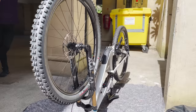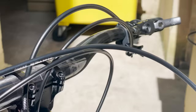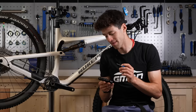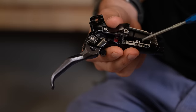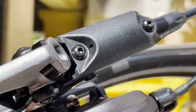Why shouldn't you leave your mountain bike hanging upside down? Most modern brake systems are what's called open. The system has the ability to self-adjust and balance the fluid level in your master cylinder within the brake lever, the hose, and the caliper by drawing or expelling fluid into a reservoir within the lever. That has its volume adjusted by a rubber diaphragm pushed by the fluid level. For the diaphragm to move, it needs to be open to the air on the other side from the fluid so it can move freely. The main master cylinder is driven by a piston, connected to a reservoir bounded by this rubber diaphragm. That can rise and fall with the fluid, but it needs a space of air to give it freedom of movement, connected to the outside world by a tiny little open port.